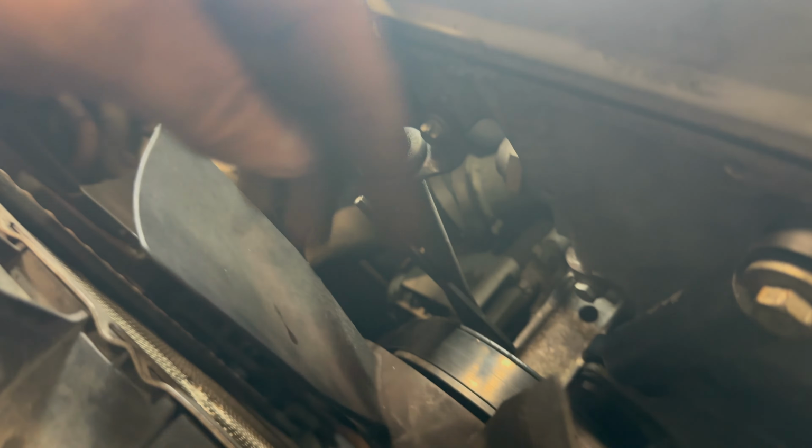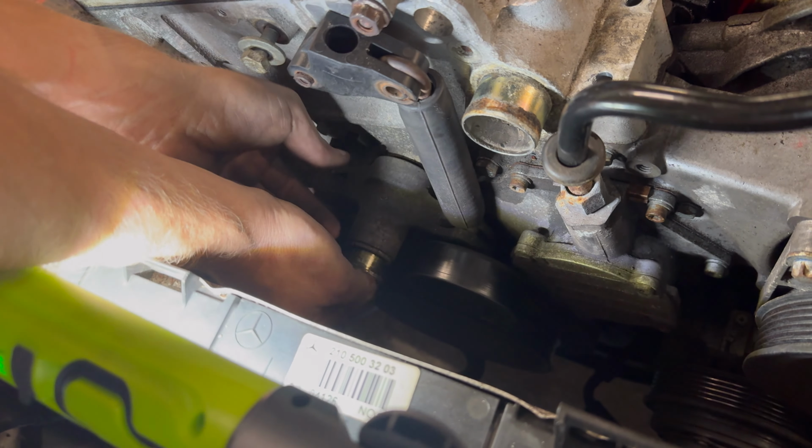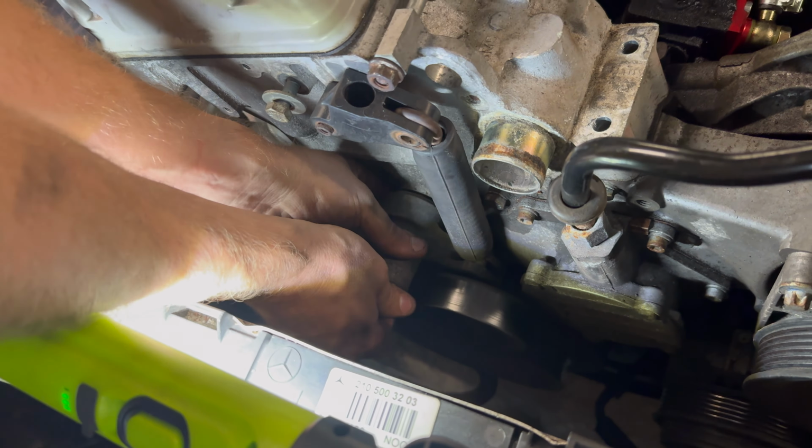It's a massive set. Like I said, I just went to the local parts store and got a 17 millimeter, and it'll loosen up everything over there on that side of where all the tensioners are. And you should already have these loose by now. All the bolts that are going around the vacuum pump are a 5mm. You want to go ahead and loosen those, and then we'll take the vacuum pump out.